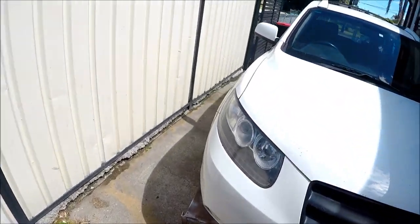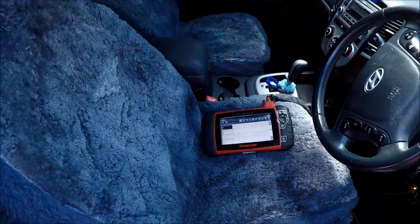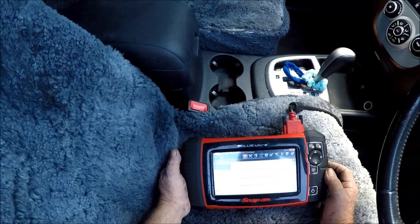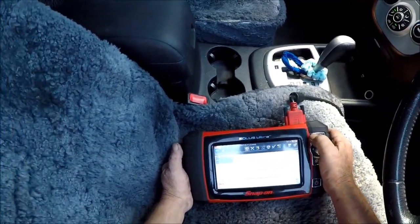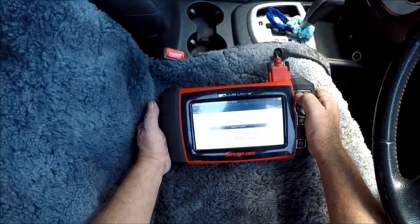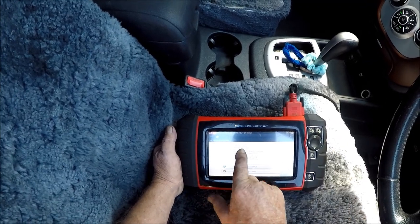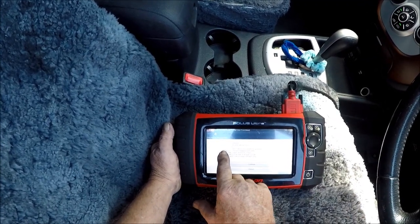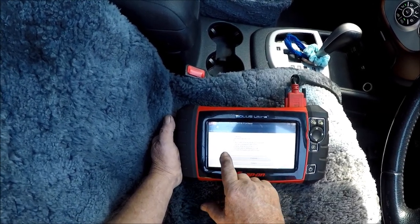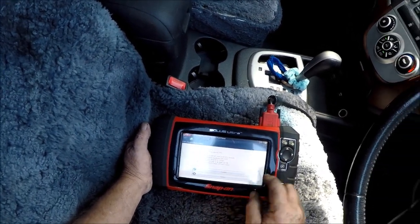Let's see what we've got — this is nearly ready. I'm not going to go into detail about what we've done with the DPF or how we've tried to trick it. There we go — there's 70, 70°C. System tests — DPF regen tells you you've got to be idle above 70°C. Now we're there, we're idling. It has a DPF. Oil level's full, it's got at least half a tank of fuel.